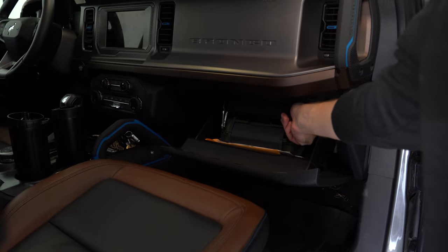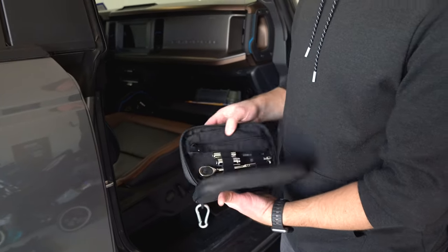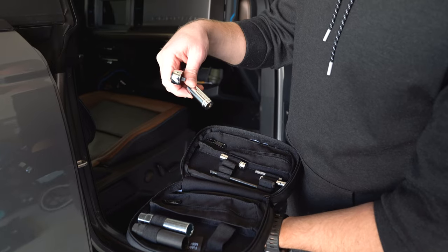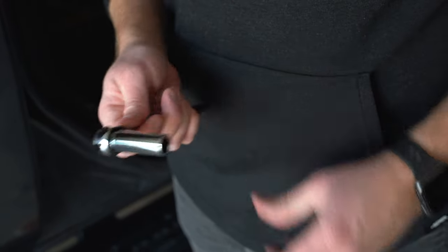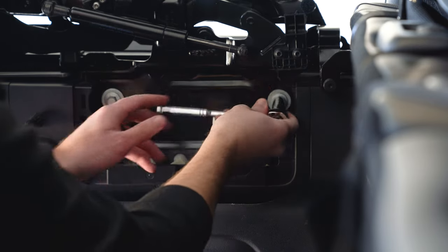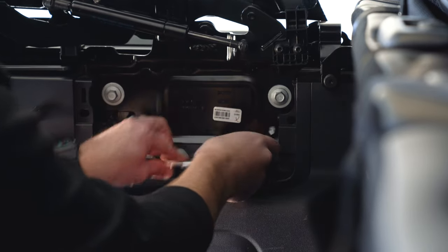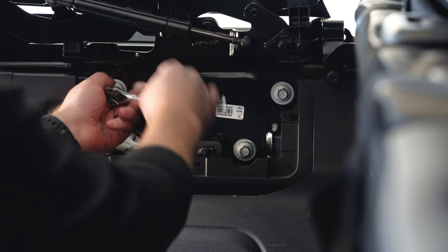Let's get the tools — they're actually found in your glove box. In this little bag with a nice Bronco logo on it, there are a few tools, but the ones you're going to need are the ratchet and the 13mm socket. Now be careful when taking these bolts off because they will fall into this well and you will never see them again.